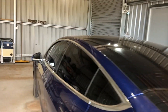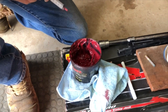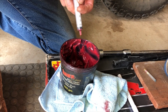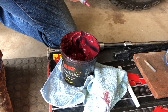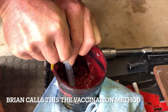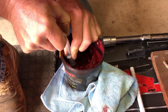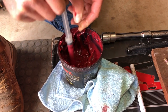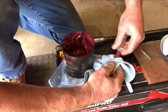We're in the process of fixing this boot problem — the creaky front end boot — and Brian has got an amazing method of doing it. The grease being used is INOX high-pressure, high-temperature grease, fairly good quality. It's normally used on high-pressure wheel bearings and things like that — anything under a bit of pressure. Brian has done 25,000 kilometres in nearly 12 months since he did his fix and it's still not creaking, even though his creak was pretty bad — embarrassingly loud. So this is a relatively easy, semi-permanent fix for that issue, even in fairly dusty, dirty rural environments.